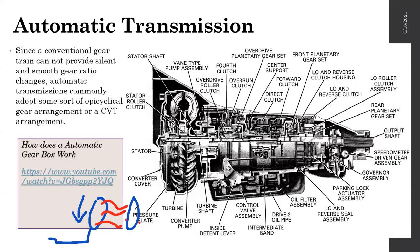At the same time, now the fan is rotating after getting enough speed. If we try to load the second fan, that means if we put a finger or something to stop it, what happens? The number one fan is still rotating, but the second fan will not rotate. This sort of coupling is known as a fluid coupling, a very well used method in mechanical engineering.